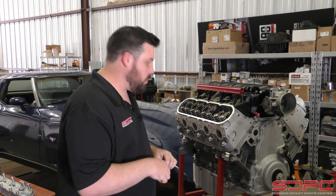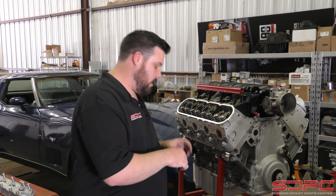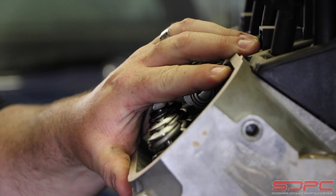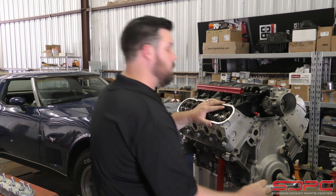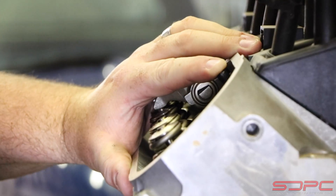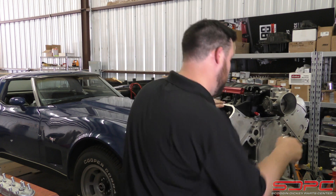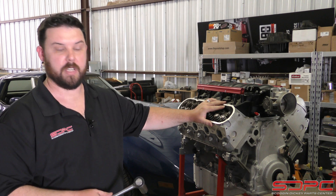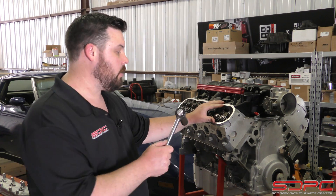The next step is to rotate the camshaft around so where it's on the base circle, so the lifter is riding on the smaller part of the camshaft. I'm going to put the tool in the pushrod hole and hold it down with my finger. I'll take a socket wrench and turn the engine over a few revolutions. Turn it clockwise — we are feeling for when the cam pushes this pushrod up, because that's where we know where we don't need to be. I'm right about the peak there, so I know that if I do one full revolution I am at the base circle. The camshaft spins half as much as the crankshaft, so I know I've got 180 degrees to the other side of the cam. Now that we know we're on base circle, we can go on to the next step.